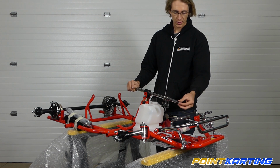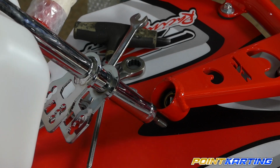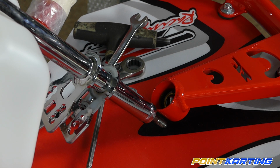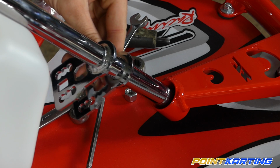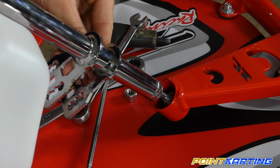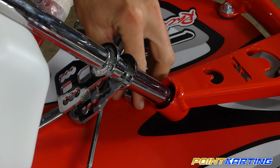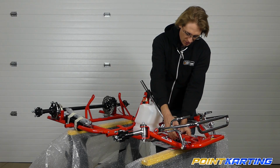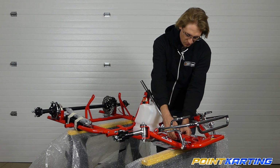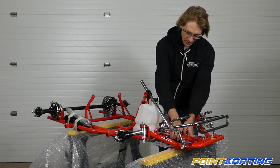Next, we'll go ahead and loosen the M8 nut, which requires a 13 millimeter wrench to reinstall. Pull the steering shaft back, realign our pre-installed uniball in the steering shaft support, and insert the threaded rod into the uniball. Once in there, we'll take the M8 nut, reach down below the steering shaft support, and the DR Mini 18 has enough room built into the chassis so that this is fairly easy to do.